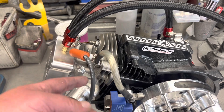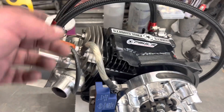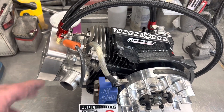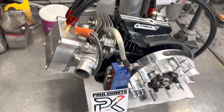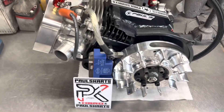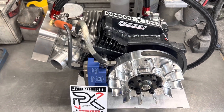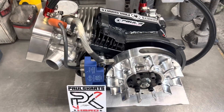Most of the 3-inch head gaskets don't have the punch-out for the oil passage anyhow. So the vapor will be going through the overflow lines — we run the 3/8-inch. This does have the welded intake tube, billet valve cover. He's got a spacer; he's got the same valve cover. He had bought the head and a bunch of parts, but then he needed a bottom end. He ended up just sending me everything he had — he didn't want a chance of it blowing up. So he was like, just build me a bottom end, do the assembly and stuff like that. Yeah, this thing is bad to the bone.